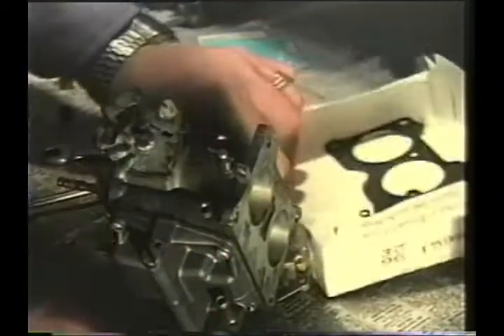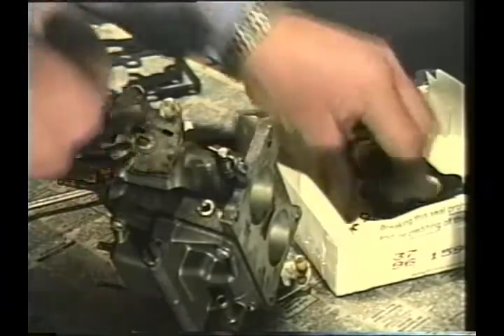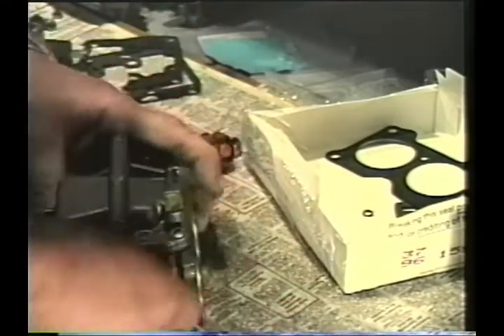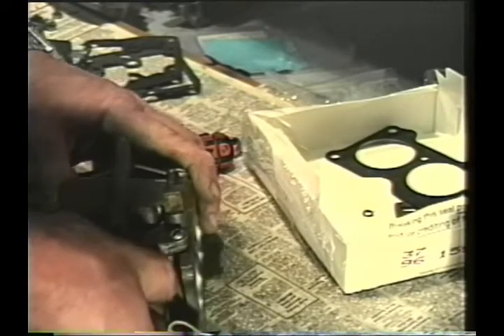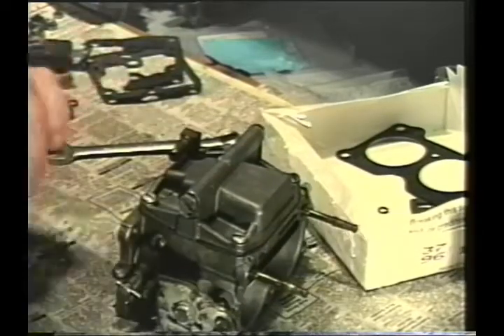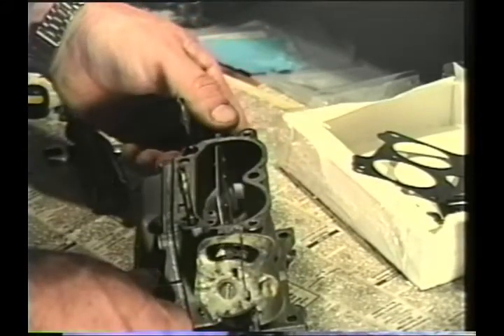The final thing we're going to do is turn the carburetor over on its side. We're going to take our two intermediate valves, put our little fiber washers on them on each side, and snug them down. Always start everything with your fingers because it only takes a second to strip them out and ruin the whole thing. Once you've stripped out those threads, you've got serious problems — so take your time. And that's it. All you're going to need now is your carburetor base and your carburetor-to-intake gasket. This carburetor is basically ready to be installed on the outboard engine.